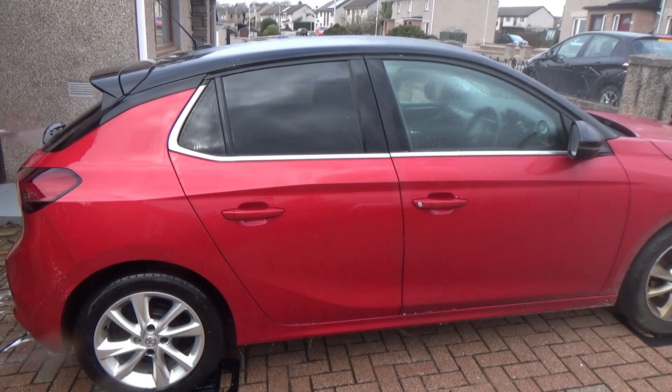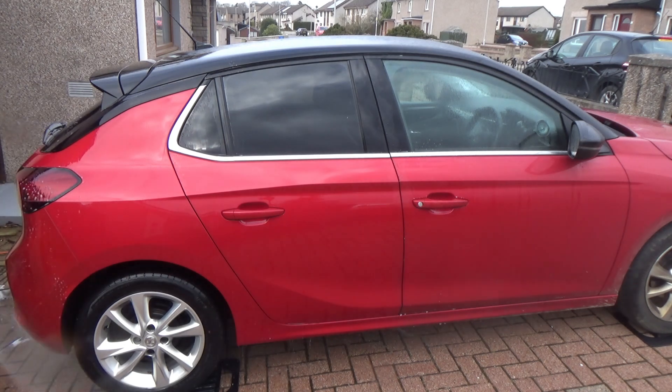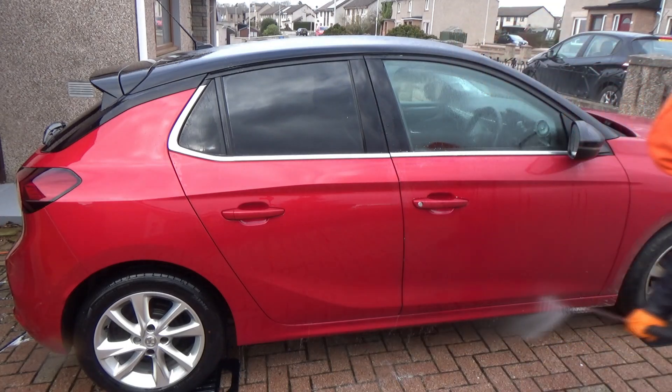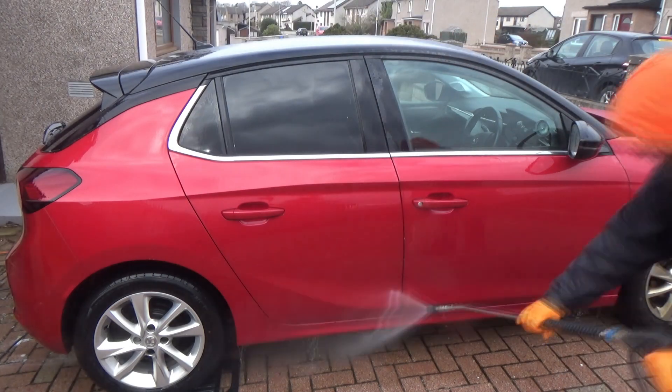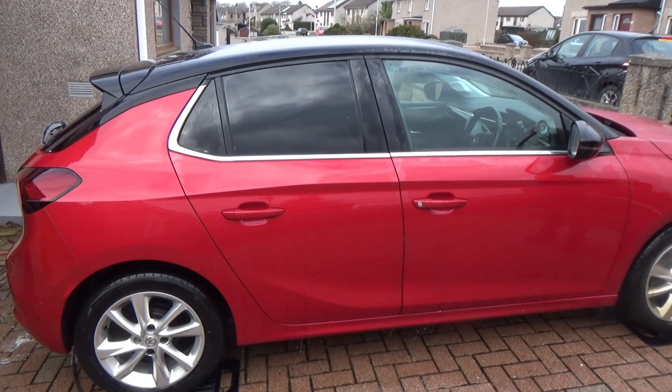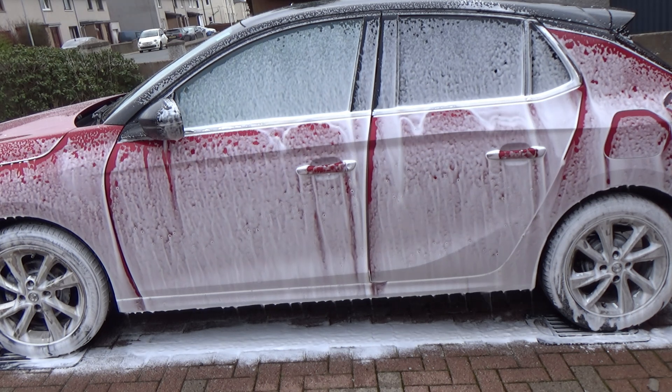Lots of people argue that the pressure washer will do the job for you. Getting in nice and close, nice and slow and even with the pressure washing. Now this is the dirt after the car had been mostly dried off with warm air. You can see the back doors have a little bit of film, but the front doors have much more — it looks like hardly anything has changed. So a pre-wash is effective. That was the Garage Therapy Snow Foam mixed at around 10 to 1 in a pump sprayer.